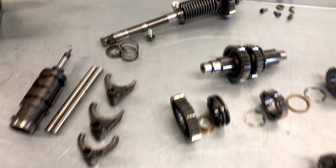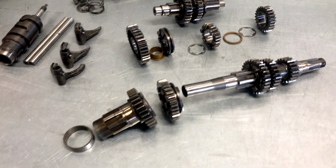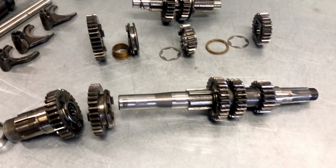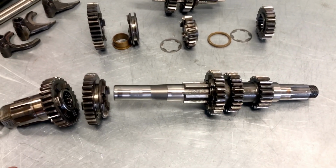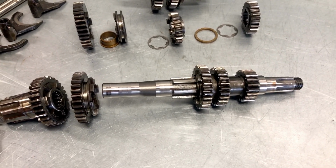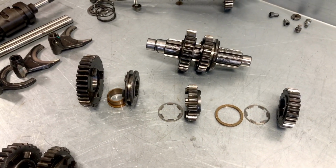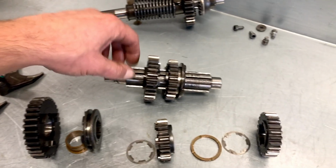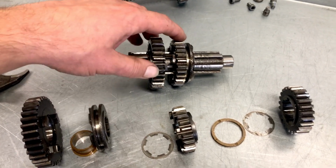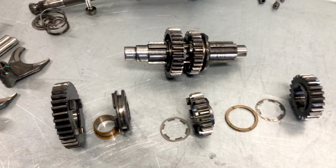And moving to the gearbox. Well, that is the reason probably why someone has been in there. The gearbox has been worked on. And what we see, the main shaft is mostly original and is in good shape. We don't see any broken off teeth or pitting or other damages. So no big issue there. The lay shaft is where they did some work. What we found is that the lay shaft itself is of an older type, probably a 750 round case. And these lack a circlip compared to the later ones.